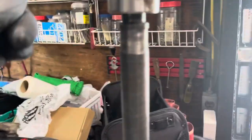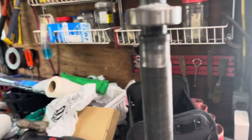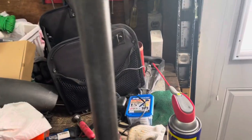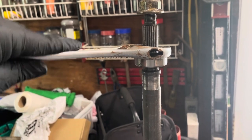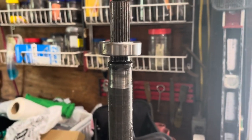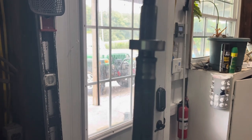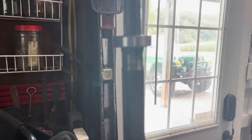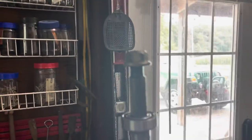Here's the setup. You have this thing on the table so it's not on the splines, holding the shaft. We've got the new bearings on here. I'm going to spray them down — give it a little WD, a little lubricant. Essentially I'm going to do the same thing opposite. Probably not three swings; I'll tap it more. Move it around, tap it down until it seats against this collar. Doing this by myself — I'll be back in a second after it's seated. You can see it's seated, hammering method. I put this nut back on here to protect the threads. I did actually hit it, but it was with a dead blow, so it probably wouldn't have hurt it.